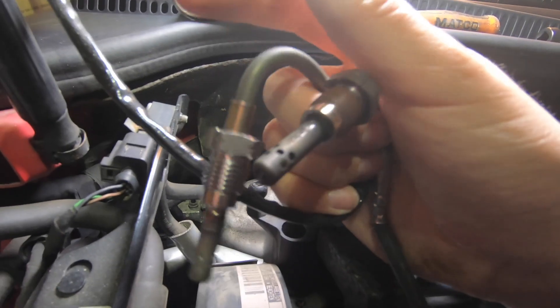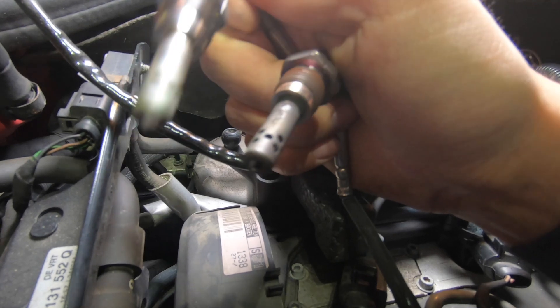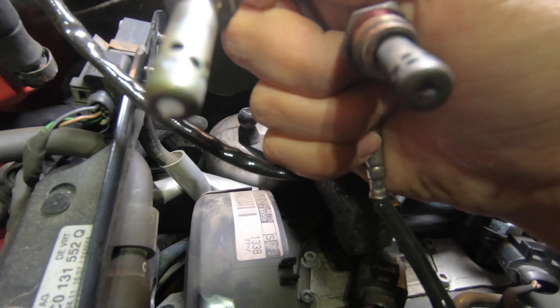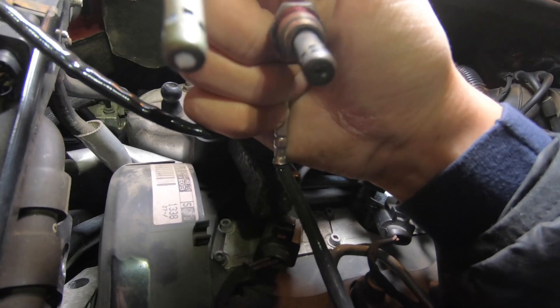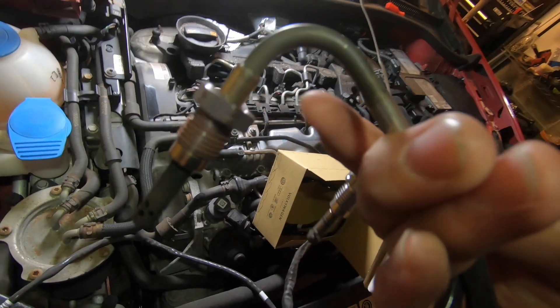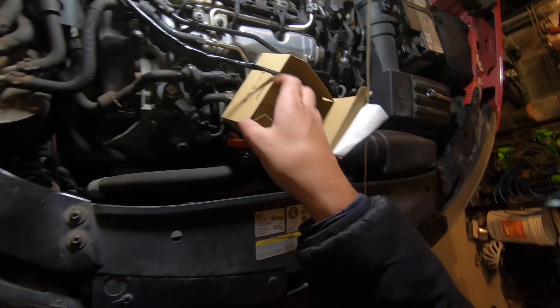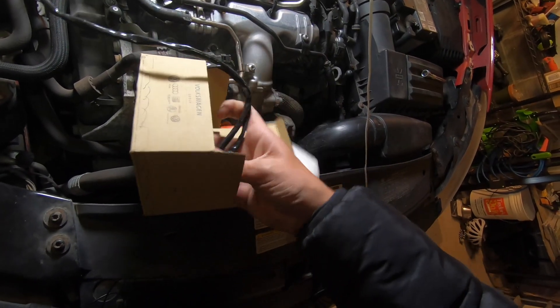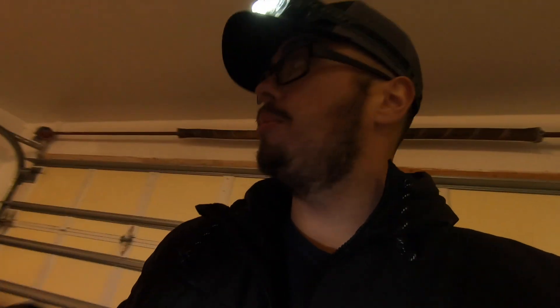The one on the right is the old one, the one on the left is new. If you do this for the first time your old one will be very hard to get out and will be black. Mine doesn't look too bad. The only difference I can tell is that the new one has a waxy substance inside it and the old one does not. Realistically it's not a hard job. There's actually a part number on here somewhere — it just says 978 at the end. The replacement part is also OEM: 03L 906 088EJ. Pay attention to your cable routing so reinstallation is easier.